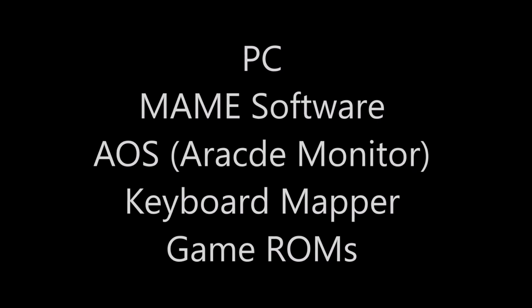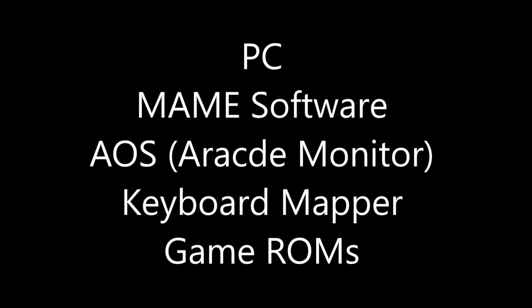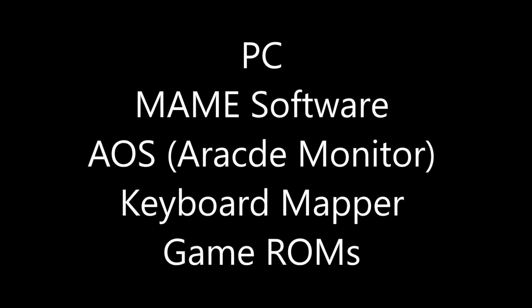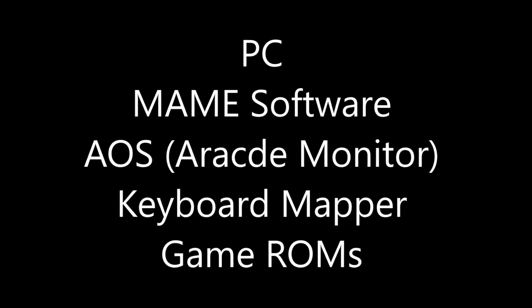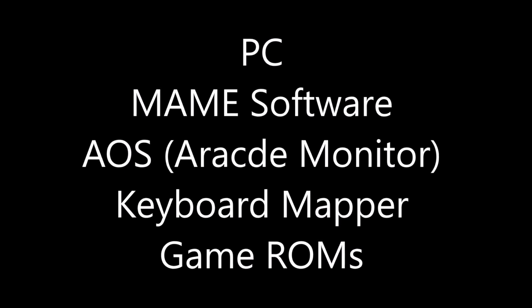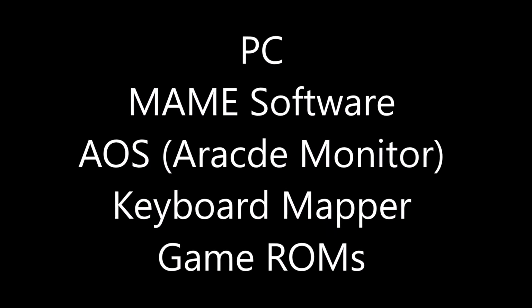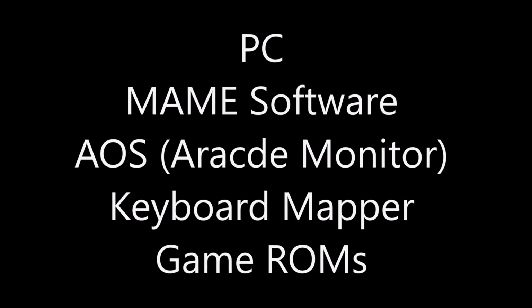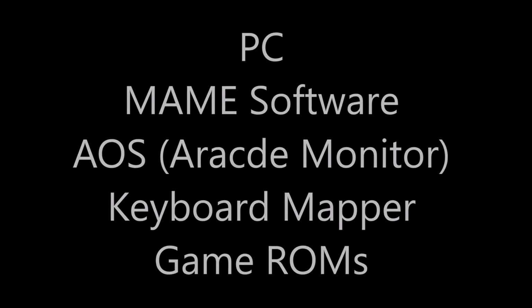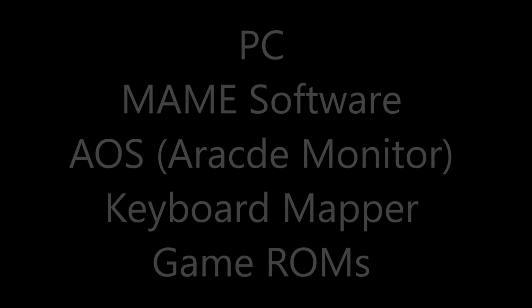All right, technology back in 2000 was a lot more complicated than it is today. So to get my MAME system working, I had to have the arcade cabinet. I had an original arcade monitor in there, so I had to have special software to convert the signal from a PC VGA monitor to a CRT. That required me to do a hack on a video arcade cable. In addition, I had to create a way to get the signals from the buttons on the arcade machine into the computer. You did this through a keyboard, and we had to hack into keyboards to send the signals into the computer.